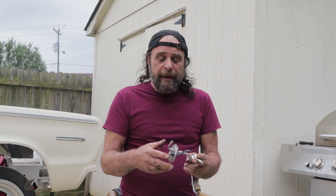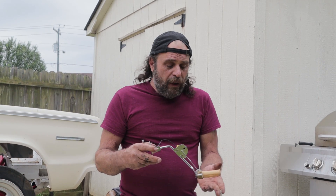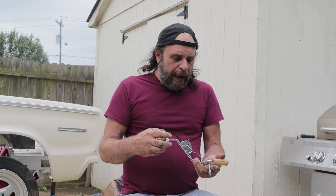So here's what happened with the Charger. We had been experiencing what we thought was vapor lock — all of the symptoms of vapor lock, which is really common with today's gasoline, especially with a big block, tight under-hood space, temperature goes up, fuel will boil inside the pump. But that wasn't the problem we were having. What happened was we would go out to about the top of first gear, bottom of second, and it would just flat run out of gas. Take a couple of seconds and it would pick back up and go. Vapor lock, right? No.